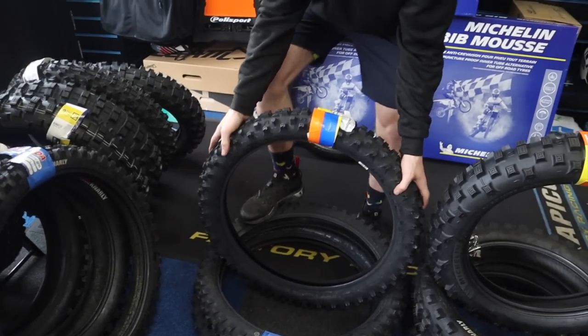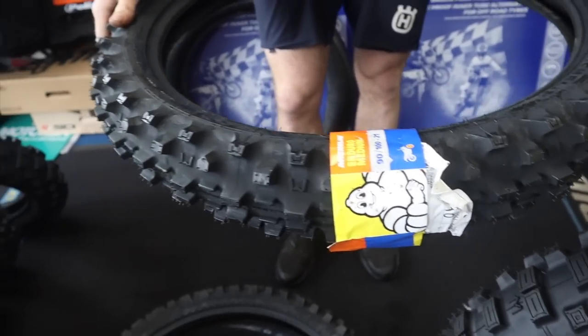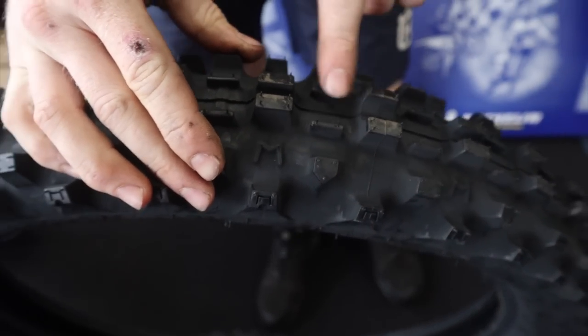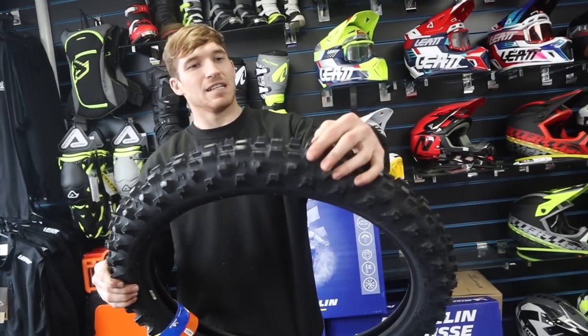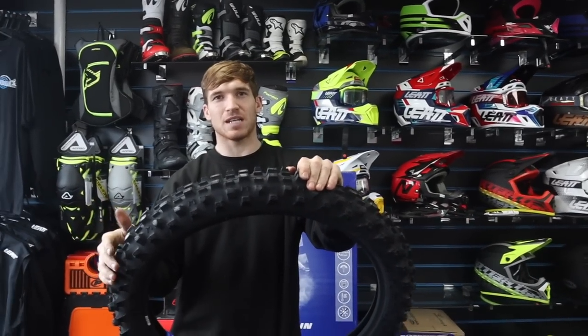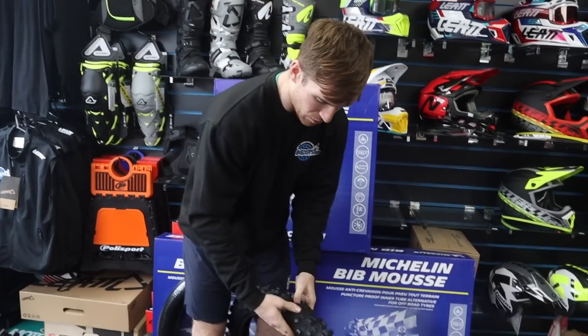The Michelin Medium front tire, 90/100-21. It's nice and squishy and it's got mud deflectors on it — so as you're riding through mud they deflect mud away from the tire. The M's are the direction markers. This tire, again 90/100 for maximum surface area, is really good on rocks. Although it's a 90/100 tire in most extreme enduro riding we run a 90/90-21 mousse in it — so it's slightly smaller, giving a plush feel and extra traction on rocks with the front wheel.